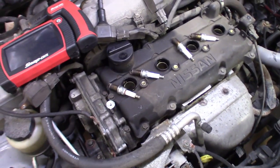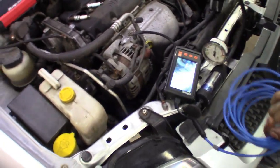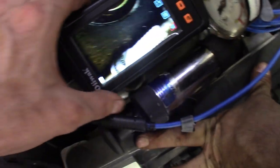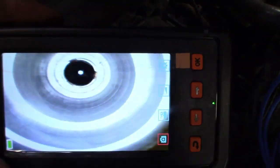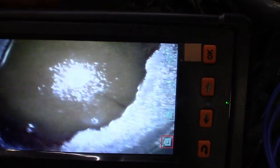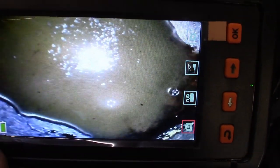We got pressure in the coolant system, we got all the spark plugs out. We're going to drop this bad boy down into the cylinders and show you guys what we saw. Steve's going to drop it down into cylinder number two. One of the main differences between these two tools are going to be the price point and some video quality. Dropping this thing down into cylinder number two — you guys can see, you can already see it shining there. This camera showed us that we definitely got an issue there. You can see some carbon build-up, but you can definitely see dirty coolant down in the cylinder. You can't even see the top of the piston.